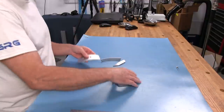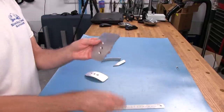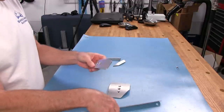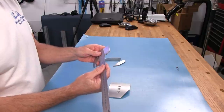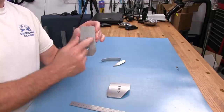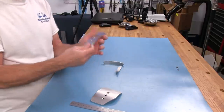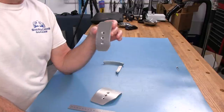So that means this one here is 80 millimeters wide. Pretty wide, right? Especially for just a clutch pedal. So now I have it at, I believe it's 46. I think after everything's said and done, it's about 47 millimeters. So another 1.5 millimeters for the kerf of the blade, and that gives us 80 here, right? If I put these two pieces back on. So the math works at least. So that leaves me, again, with a 47 millimeter clutch pedal.